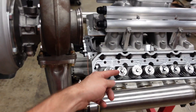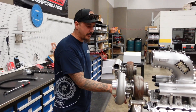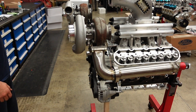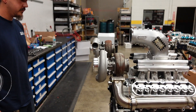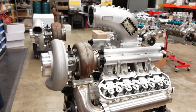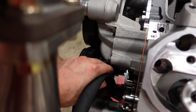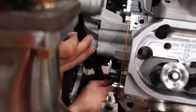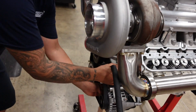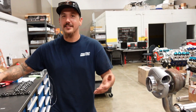On this side, I can't go to the valve cover because the drain would have to go around the actual header part of the exhaust. It's possible we could use some heat wrap and run it this way to keep them symmetrical — symmetry is beauty. But for turbo drains, I'm okay sacrificing a little symmetry; I'd rather have gravity working with me. On this side, we have a perfect straight shot out of this drain straight into the timing cover. We might have to weld some sort of extension to hold it out a bit, or maybe a one inch spacer, plus a P-clamp to hold it steady.